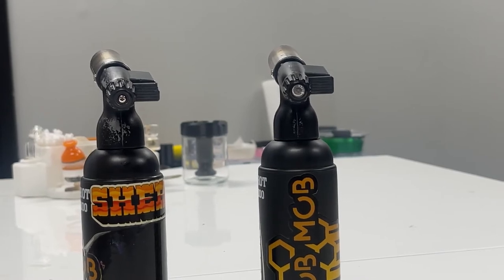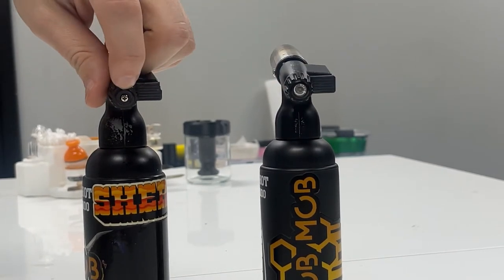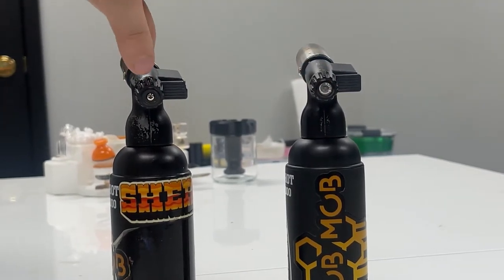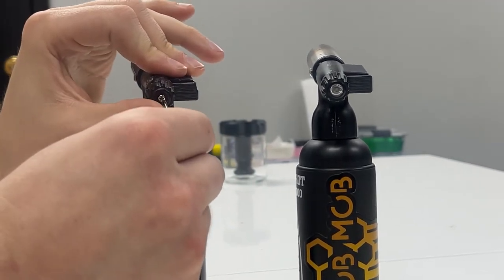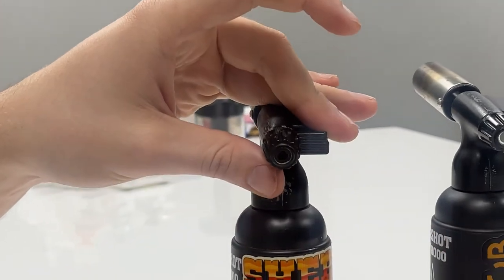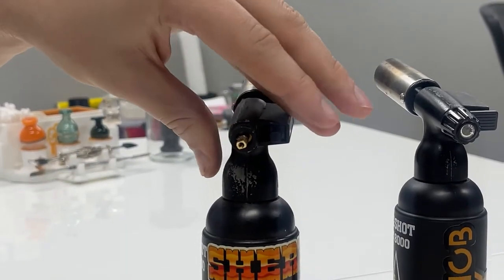On the back of the blazer there's a small sticker located on the knob. Underneath this sticker is the screw that attaches the knob to the internal valve mechanism. By removing the sticker you can then unscrew that screw and take the plastic knob off like so. And once you take the knob off, the button is going to fall off just like that.